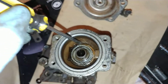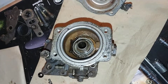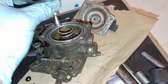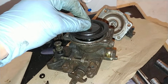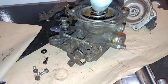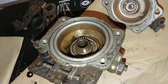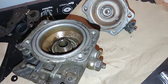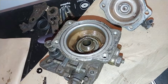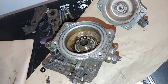Another super common thing is this star wheel in here. People will grab a flathead screwdriver and turn it around. The reason that actually helps you is because you are de-tensioning this spring — this is your return spring that, under zero boost, wants to return you to the all-the-way-up position where you can't add more than a tiny bit of fuel. By taking that star wheel and adjusting it all the way down, your spring rate is softer. At say 10 psi boost you're allowed to add maybe five percent more fuel — not a really significant amount honestly. Between the smoke screw and that it's noticeable, but it's not a crazy large amount.